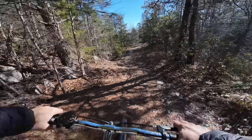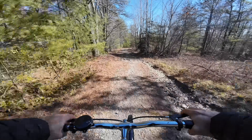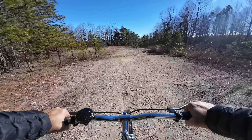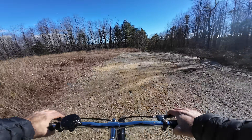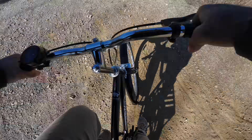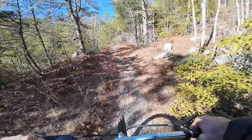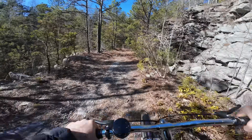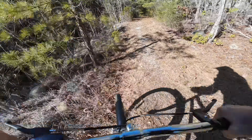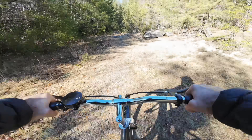I have the bike now on some pretty rough gravel roads, which are not unlike the roads that the bike would be used on in Africa. Right now I'm in the cruising gear, which feels a lot like the gear on the original Buffalo Bicycle, and it allows you to pedal and go pretty fast. But going uphill, it's really, really hard to pedal in this gear — I'm actually standing up and pushing down as hard as I can. So I give it a pedal kick back, and now in the low gear, I can climb a pretty decent grade without much difficulty. It's not super low like Eagle, but it gets the job done. Then it flattens out, I kick back, and now we're back in the higher gear — we can get up to some pretty good speeds. Pedal kick, back in the low gear. It works so well.